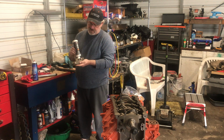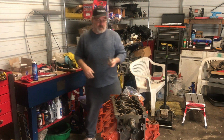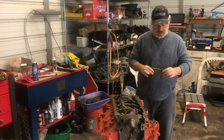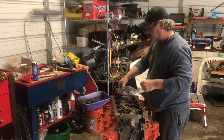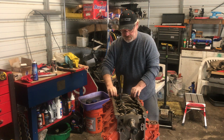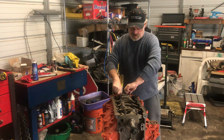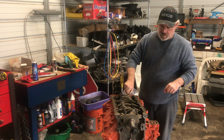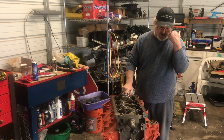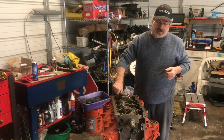And with this 5.7, here we're actually doing the Eagle head swap on it. This is a pre-Eagle motor, which is from 03 to 08. And of course, y'all know everything's had their issues. But I like doing the Eagle head swaps. You get more compression. You don't have to worry about the valve seats dropping in them.